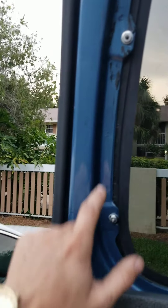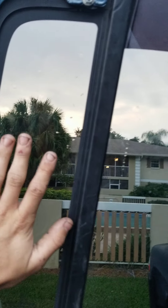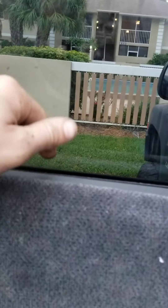There are two bolts that hold this piece in, aside from these three bolts that have to come out. After that, you're going to push on this window through, and it's going to come out like this. Then what I did was rotate it this way, slide it up about halfway, and then you've got to kind of manhandle it through the very little opening you have with the window.